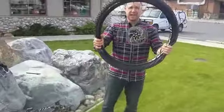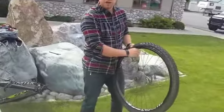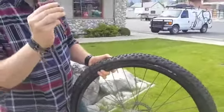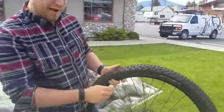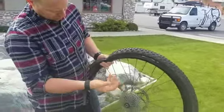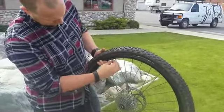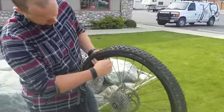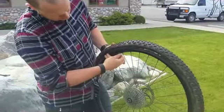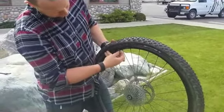So next step is to get the tire and tube off of here. This is a Presta valve, which again, people are a little bit afraid of. These caps are completely useless. Throw them away, never use them again. This right here, you're completely out of air. You back that out to make sure that all air is out. Take off your retainer, which is this little circly thing.